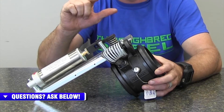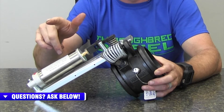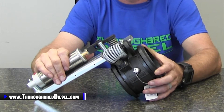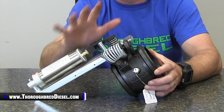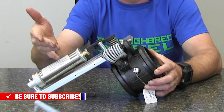For Ford and Chevrolet guys, we only offer the inline mount. Chevrolet guys, we have exhaust brakes for you on the Duramax from 2001 to 2007 through the LBZ platform. There are no exhaust brakes for the LMM, LML, and L5P. Ford guys, we've got you covered on the 7.3 engine and all the way through the 6.0. For inline mounts, another caveat: if you have five inch exhaust, we do not offer five inch exhaust adapters on the inline mounts for any of the four inch exhaust brakes.